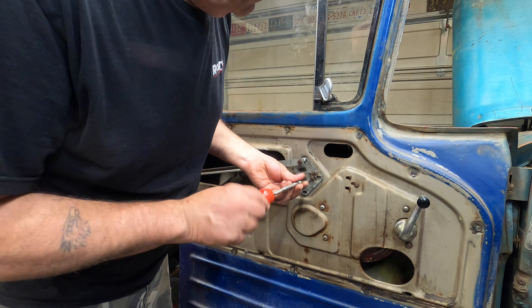So there you go — we got the entire job done with a Phillips screwdriver. Unfortunately in my case somebody had gone in already and siliconed the bottom of that window, and then I went in and JB welded the bottom — probably not doing myself any favors, but full transparency. I just want to get the job done. If you're replacing just the vent window: roll your window down, pull out these four screws, pull out these two screws, pull it down, back this way, up, turn and out — Bob's your uncle. Reverse that to put it back in.